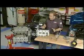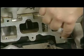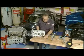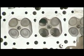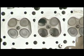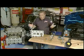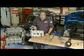And if you think that's all — lots more coming up. See, buried way deep in the engine, clear down in here — valves, intake and exhaust valves and valve seats. They are different; they're made of a metal that doesn't erode when you use ethanol. So you're looking at a major operation right there. The cylinder heads have to be replaced.